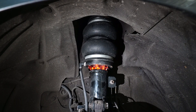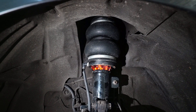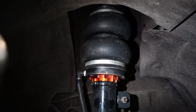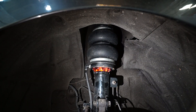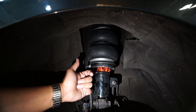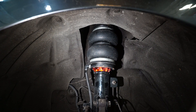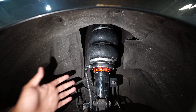Hello and welcome to the front suspension of the Mazda 2 Skyactiv. This video will be cross-compatible for the Ford Fiesta, since Mazda and Ford share a chassis for the Fiesta and Mazda 2, and the Ford Focus and Mazda 3. Right in front of us is a coilover conversion of K-Sport — we converted the K-Sport into air springs. You can see the airbag and the iconic orange lock rings of the K-Sport coilovers. We use K-Sport coilovers because they are the most comfortable for street use and they have 36 adjustments.